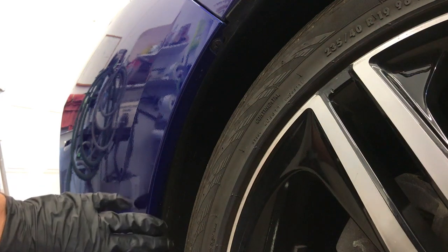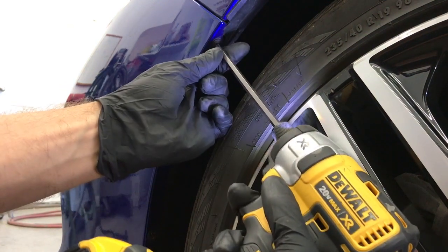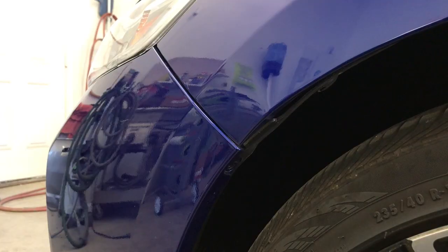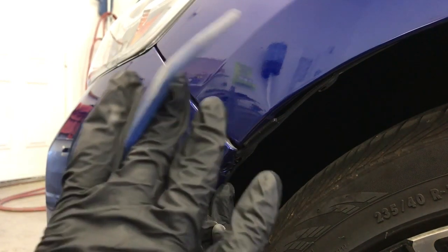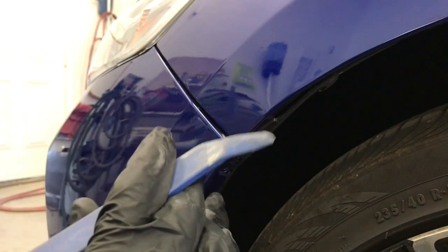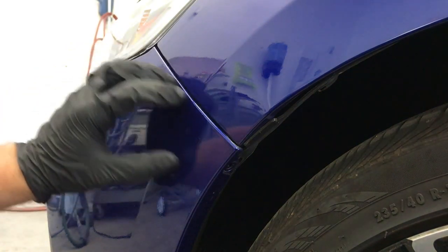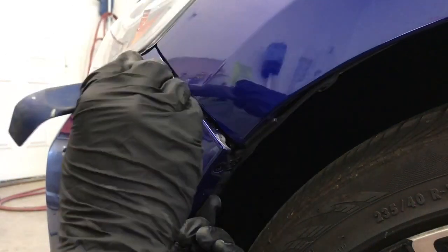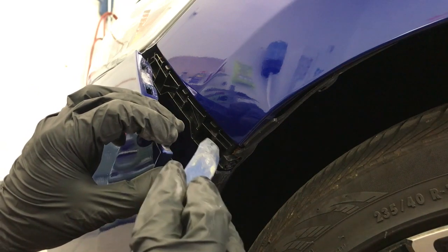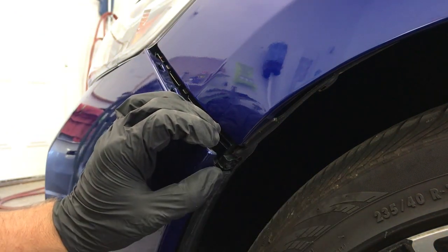Next, come around to the side of the cover — there are two Phillips screws that need to come out. Then with one hand pull out on the bumper, and with the other you're going to want to take a plastic pry tool. You can get sets of these on Amazon — I'll also link to those in the description. There are little plastic tabs on the plastic bracket behind there that clip into the bumper and hold it on. So what we're going to do with the plastic pry tool is pry down on these slots to release the bumper from that plastic bracket. You can see the holes in the bumper — that's what we're prying down into. Do the same thing on the other side as well.